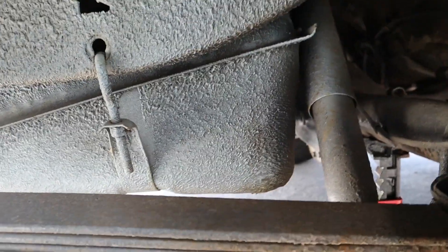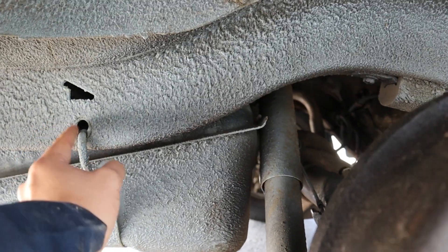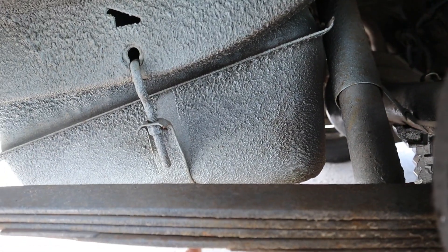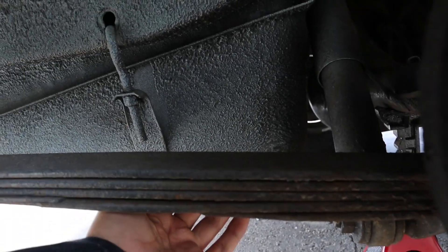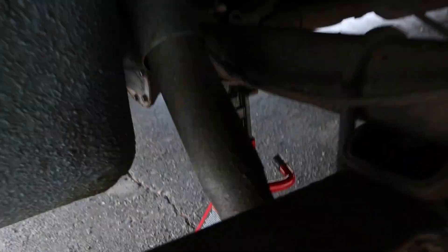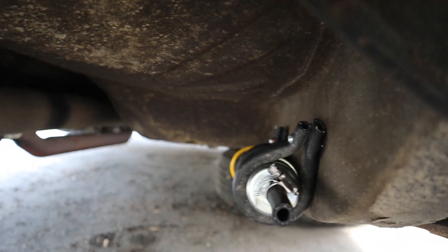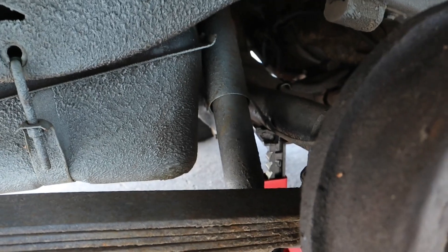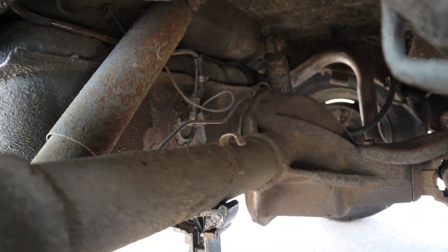On my brown car when I installed the electric fuel pump, I mounted it on the rear part of the unibody and welded in a piece of steel that dropped the pump down to the lowest point in the chassis. It's a lot tighter here on the A-body Valiant than on the B-body, so I mounted it on the inside of the unibody U-channel under the floor pan, which is pretty much the lowest point in the chassis. There's the fuel sending unit there, so I need to hook up my steel lines to that, and then it'll hook up to the pump and keep going ahead from there.